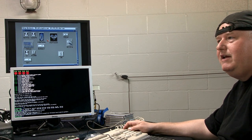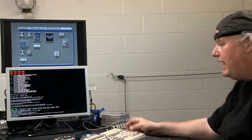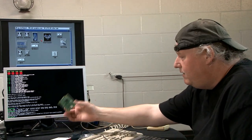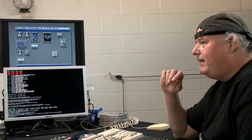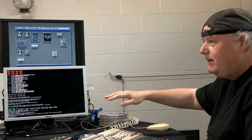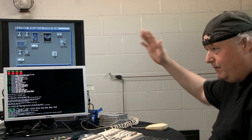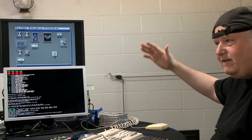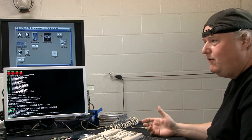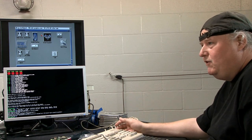Yeah, so the 128 megs of memory, that's reading the memory off the Pi card, right? Yeah, it's coming off of here. And you can set that. Like I can add 256 if I want. I go into the configuration file, and there's a setting. I've noticed that at 128 it's stable and below, but at 256 it was acting funny. So I'm not sure if they're working on that. It's some sort of timing issue.